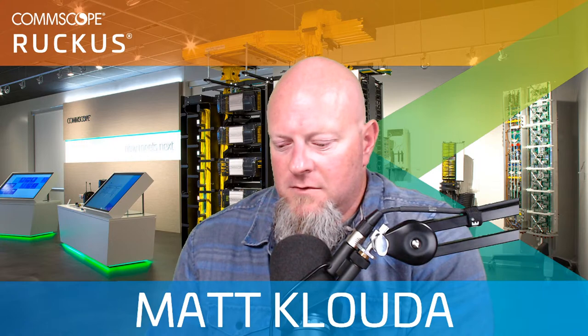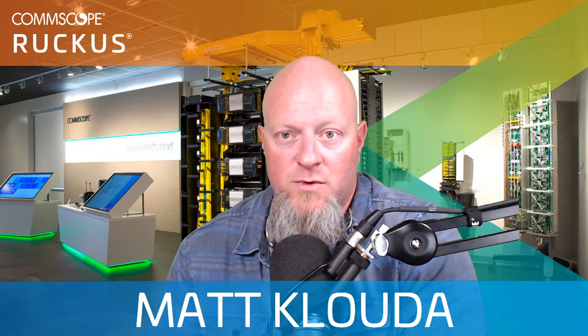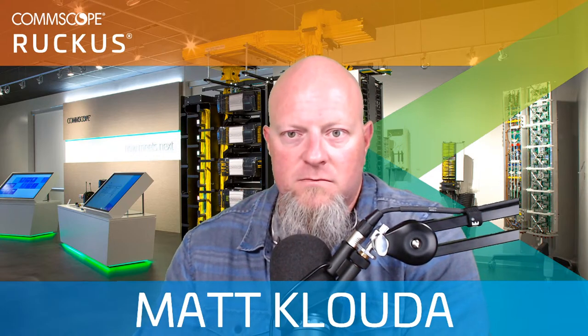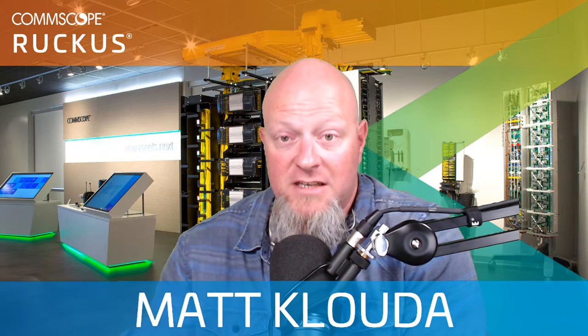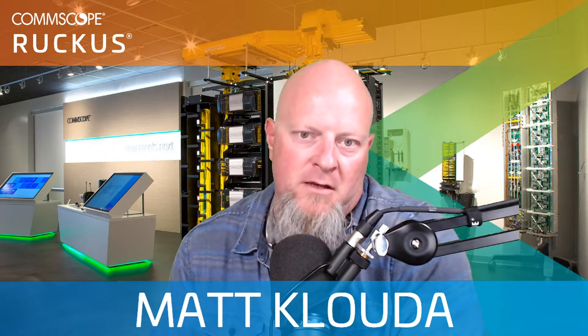Now, keep in mind, if you're streaming video on Netflix, YouTube, all of that video content is compressed so that it streams well, so it doesn't buffer, so you don't run into issues like that. If you were streaming 4K video, which is the highest, most pristine video signal you can get, to stream that, you need a pipe of 25 megabits per second. That's it. So when you see a 400 or 500 megabit per second speed test, fear not. Everything you're trying to do will work perfectly fine.